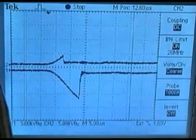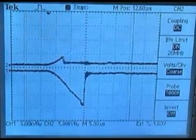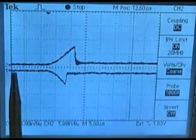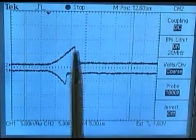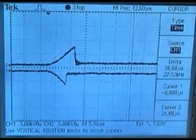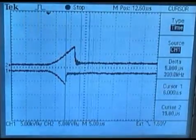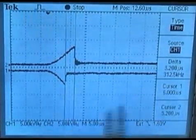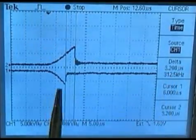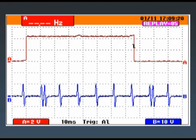I'll try to catch it the opposite way. Here — number 4 is firing on compression and number 1 is firing on waste. If you put the cursors, there is some time difference between the break-over edges. On that particular event, you're looking at 3.2 microseconds between the time number 1 broke over on waste and number 4 broke over on compression. The Compression Sense Ignition system infers the cam signal from the capacitive energy in the ignition secondary. The duty cycle of the cam out signal is 50% if the system does not have a misfire.